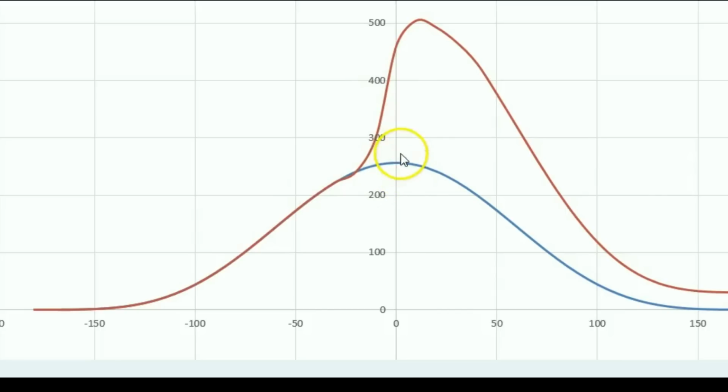But if you fire the piston at this point, what's going to happen is that, well, the reason why you advance the ignition is that you're trying to raise the cylinder pressure up higher, because the whole point of compression and the whole point of raising cylinder pressure is to make the combustion more spontaneous. You're raising cylinder pressure inside the engine so that everything is at a higher pressure, at a higher temperature, so that the air-fuel mixture burns quicker.